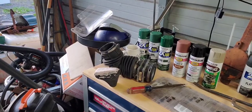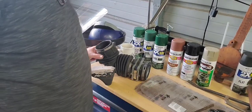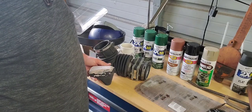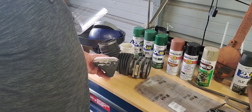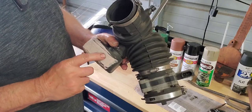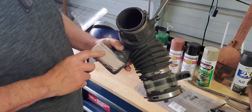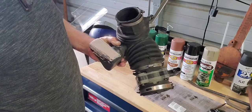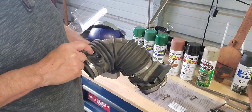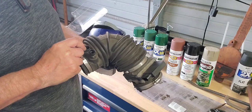Well, fellas, this is how much y'all mean to me. The battery went dead in my phone, which is what I film on. And I went ahead and I charged it up and I waited so I could show you guys. Well, the way it wound up, that was a direct draw, a direct entry into my intake. So it was sucking air here, and it was sucking air through this port here because that hose was off in the back. So I'm gonna do my best to plug this up.